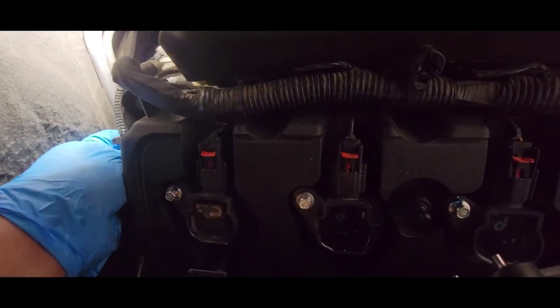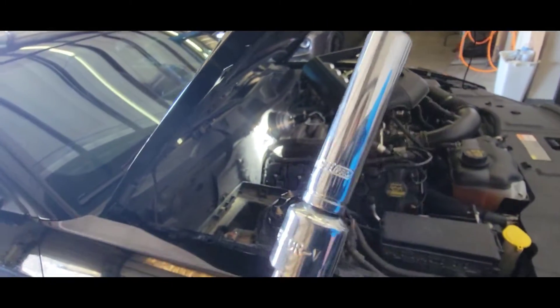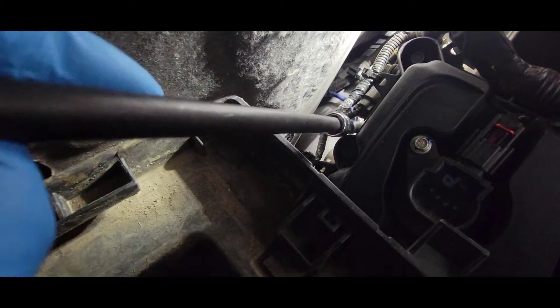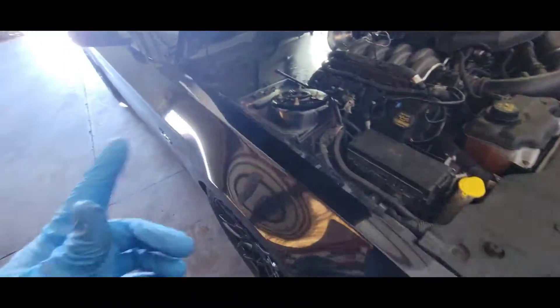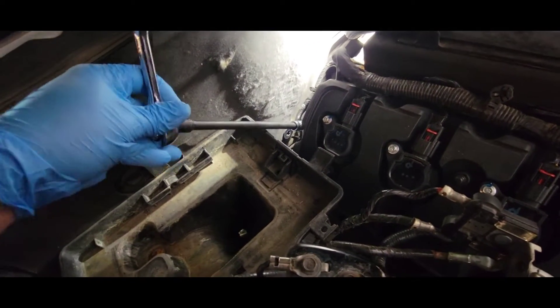It's straight down there. Now we have to connect this pigtail into place. It looks like the lock is going to be facing the engine block, so going forward. You just want to have this pigtail basically like so, and then clip it in. We'll secure that sensor down. I'm going to be using an eight millimeter long deep socket with a couple of extensions to reach in here — it is a pretty tight spot.